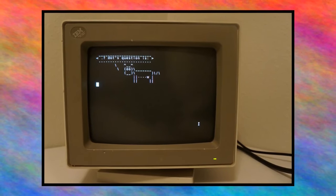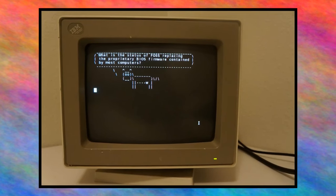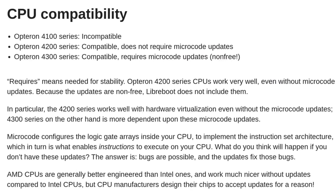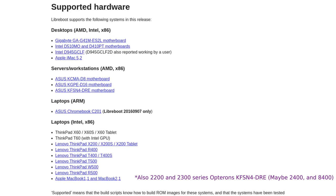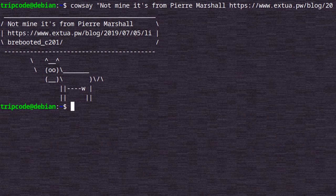Dot's question is: what is the status of FOSS replacing the proprietary BIOS firmware on most computers? Libreboot had a recent release. It still supports mainly Opteron 6100, 6200, 4100, and 4200 for larger workstation and server boards, a lot of Core 2 Duos from the ThinkPad line, and a single Chromebook with an ARM processor.